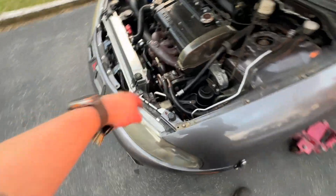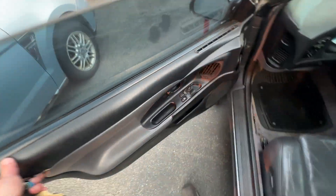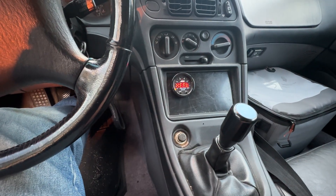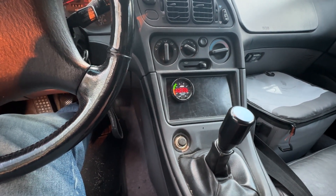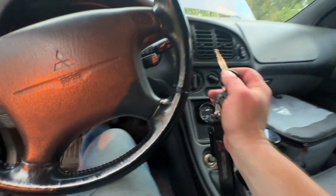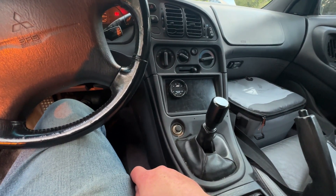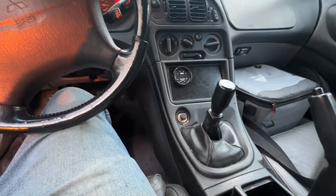All right, we got this thing thrown in — all I had to do was snip one zip tie. It's in the downpipe; I'll leave the wire loose for now since I have to affix it shortly. We're not going to fire it up yet — just going to do a key-on and see if she wakes up. Heat — things are looking good! There was a comment from a guy saying not to let it warm up and then start it, because cold exhaust gases rushing past the heated sensor can crack it — who knows, maybe that's what happened.